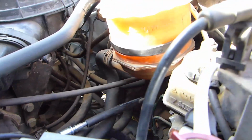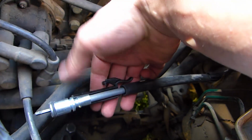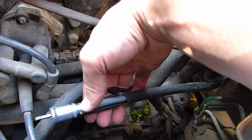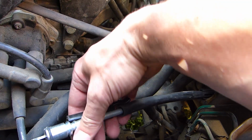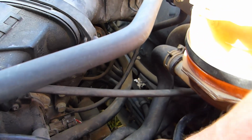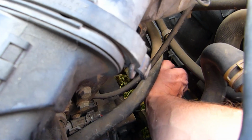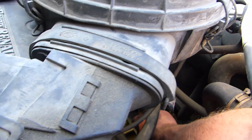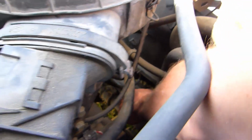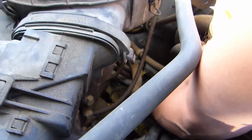And once it's plugged back in, you can put it back on into the gearbox. But first, make sure you put back this thing, which will lock it in place. You can't really get it wrong. Put it in this groove here. It should just pop in like that. Now it went behind the coolant hose and back into the hole I showed you earlier on. Push it all the way in and make sure it can't come out again by locking it with the little black tab. Alright, if you pull firmly onto it and it doesn't come out, it's good.